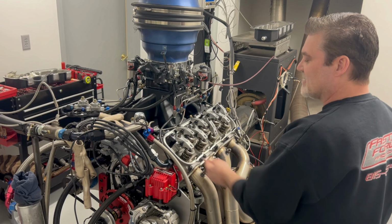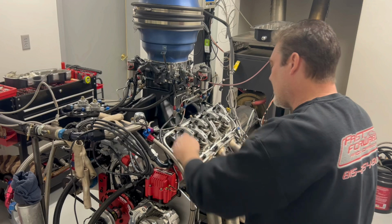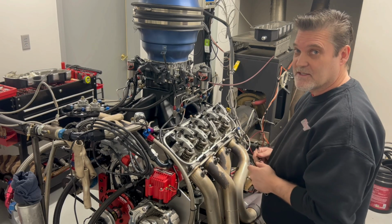That locks it in real good, and look, adjust valve, that thing is perfect almost every time you do it that way. It's got just a little bit of drag on there. So if you give it a crank and then both of them a crank, you'll get that every time, and then you'll just be able to go right down the line, boom, boom, boom, boom, boom, and within minutes you'll have your valves adjusted at the racetrack.